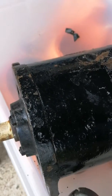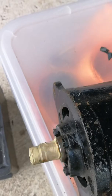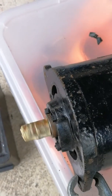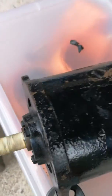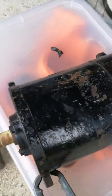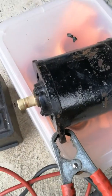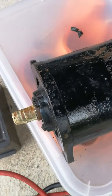That's going to make this dynamo suitable for a positive earth vehicle. When I connect this, it spins as a motor. So that dynamo, when I put it on the car and connect it up, is going to generate for positive earth. If I wanted it to be negative earth, I would simply reverse these connections and it would then be a negative earth dynamo.